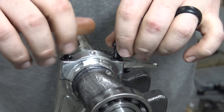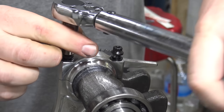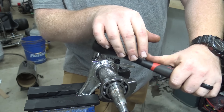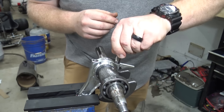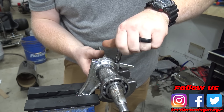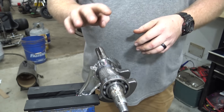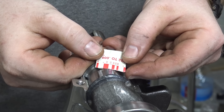This calls for 26 foot-pounds on the rod bolt. I start at 15 and work my way up a couple pounds at a time. I always use a regular ratchet to break these loose, not my torque wrench. The only other thing I think it could be is end play in the crankshaft — these are Chinese engines, so if that's the case I can shim the crankshaft. After checking, make sure to clean all the plastigage off the bearing and crankshaft. That is dead on three thousandths — exactly where we need to be.